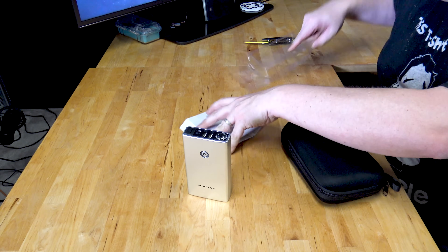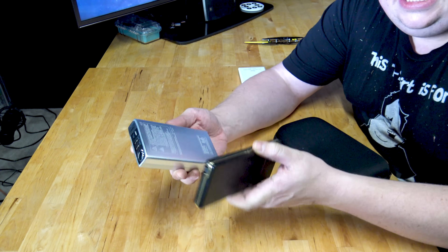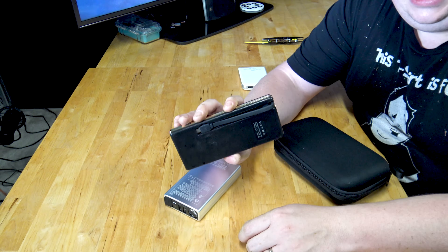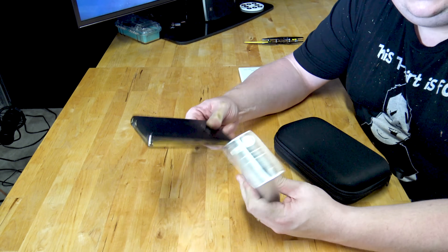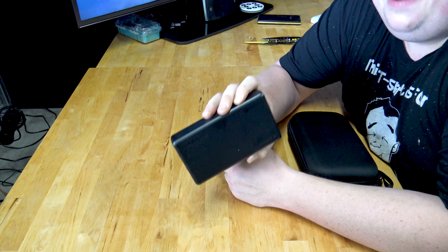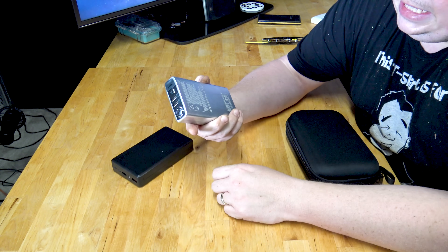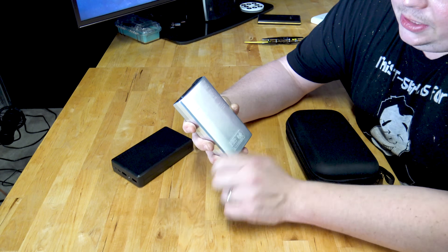The thing that threw me was it's only 8,000 milliamp hours. 8,000 milliamp hours is tiny. This little super thin pack is 12,000 milliamp hours, and this one is only 8,000. This little thing right here is 11,200 milliamp hours. And this is 30,000 milliamp hours — just a little bigger, but this car starter is only 8,000 mAh. The reason it's so big is because obviously it can start a car, which means it can discharge all of that amperage at an alarming rate. The cranking amperage on a car and a truck is huge. This thing has to be able to put out that 8,000 mAh really quickly — almost deplete the entire pack to start the car a couple of times.